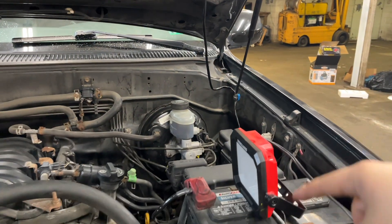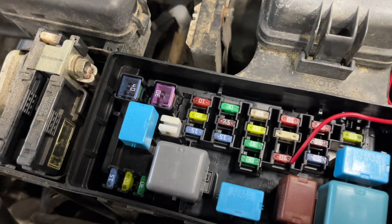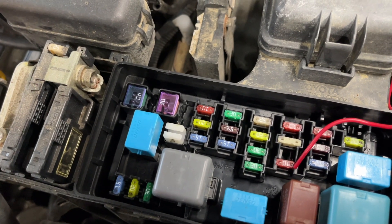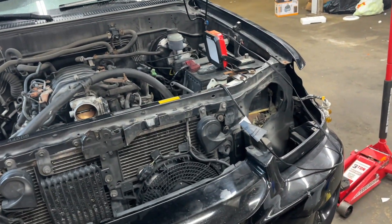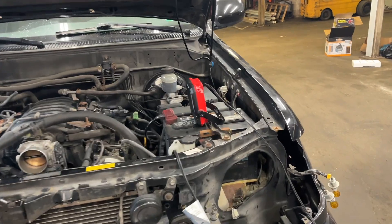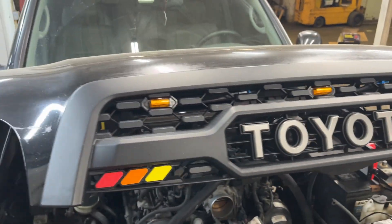So I just have a cable going here, connecting to ground and then into a fuse. For those lights, I used the ETCS fuse — that was the one that had constant power when the vehicle was on. I've actually noticed they come on at night in the middle of the night because it's the ETCS fuse, so that seems to be a good power source for the red lights. You just ground the negative somewhere on the body — I believe I have it grounded right here. Right now I have the battery disconnected because I'm doing the timing belt, but I wanted to jump in and make this video while I had a few minutes and show you the quality of this grill.